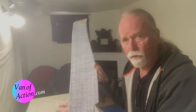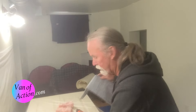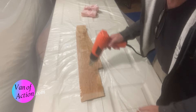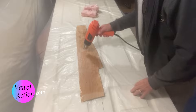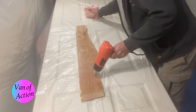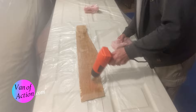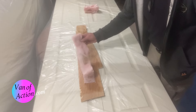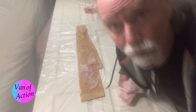Check this out — this is one of the corner panels beside the door, a piece of trim. I peeled the vinyl off. This has been on for three years. Now add a little heat. Look at that — it's sticking. It's glue again. After three years, the heat reactivates the contact cement.